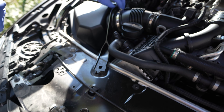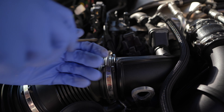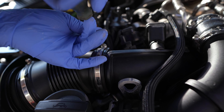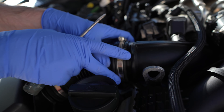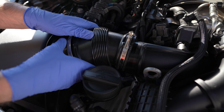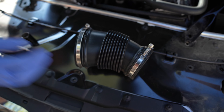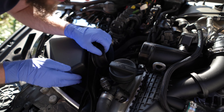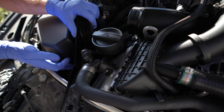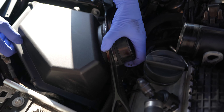Okay, nice — this guy just comes up. Now you've got some play. Let's do the other one now. That's definitely loose enough. Just got to pop it up. Let's figure out how this one comes out first. I think we might have to disconnect the hose here — probably grommets. Yeah, there's a hose here that's in the way that has to come off. I just yank that out straight, and now it's loose so we can pull out the whole intake housing. It's grommets, so don't be scared to pull it.